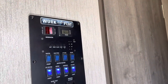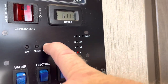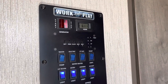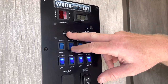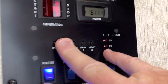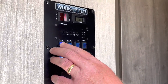Here's your control panel for this work-and-play toy hauler. You're going to see some gauges — battery is full, fresh is almost full, black is empty, gray is empty. There are two gray tanks, both empty. We'll have the waste tanks empty and the fresh full when you pick it up. Turn the water pump on right here to get fresh water from any of the water features. If the water tank gets below one-third, turn off the water pump or it will burn up — and that's an expensive repair you don't want to be responsible for.